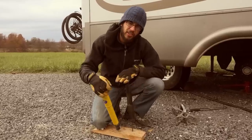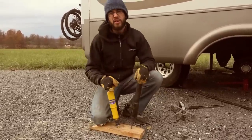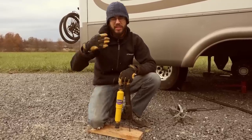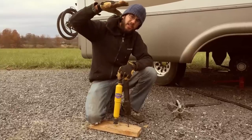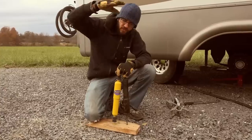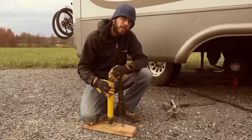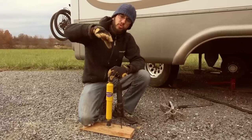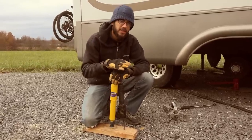The shocks are very difficult to move. If I press down on this, you'll see that it moves very slowly, and what that's going to do is stop the wheel from bouncing. Once the spring bounces up, it's going to settle back down to its normal position instead of continuing to bounce. This also helps in cornering — as the RV rolls to one side, it could roll back and sway back and forth, and the shock absorbers are going to help with that as well.